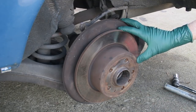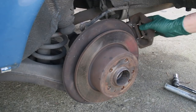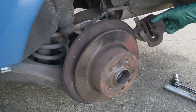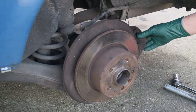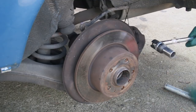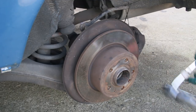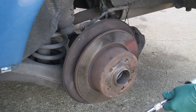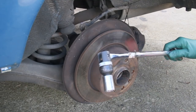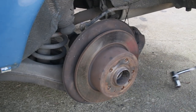To inspect the emergency brake assembly you have to remove the rear brake caliper. I've set it up and zip-tied it to the sway bar. Sometimes it's a real challenge to get the bolts out on these calipers, especially when working on the ground. I use a breaker bar, and I always have a pipe handy. With a breaker bar and a pipe you can get these caliper bolts out without working up a lot of sweat. So we got those off.